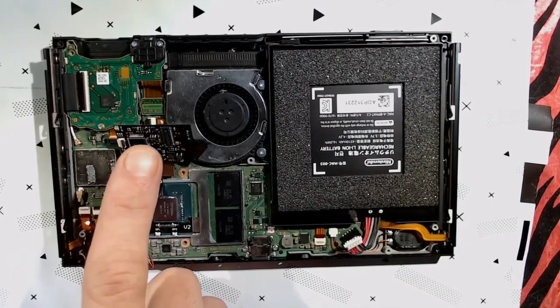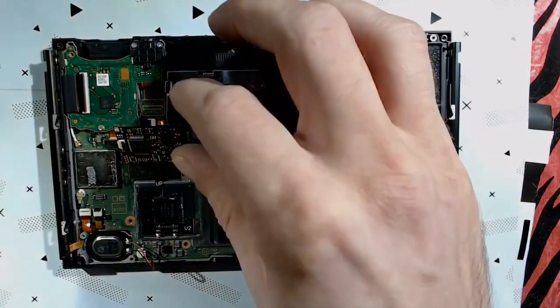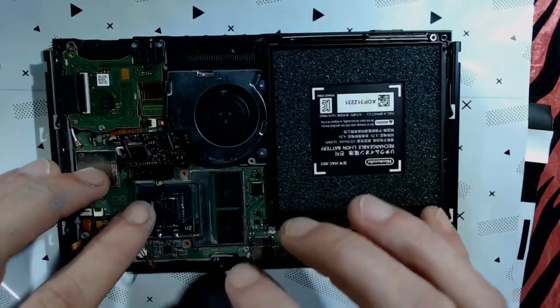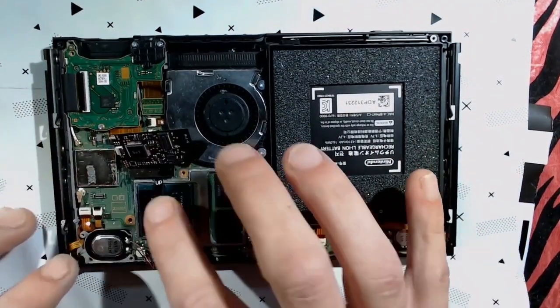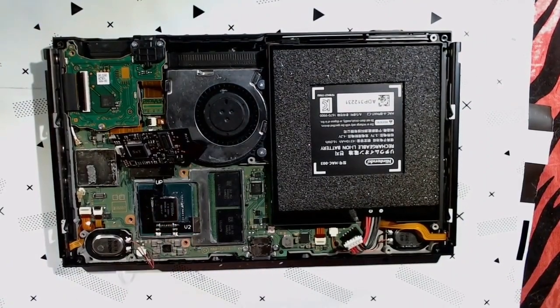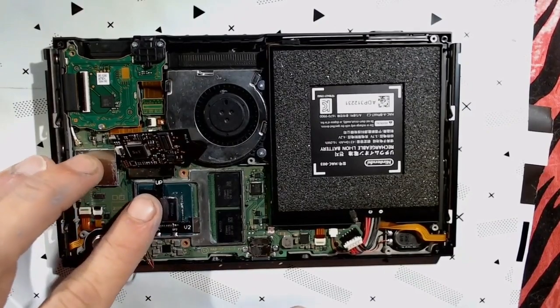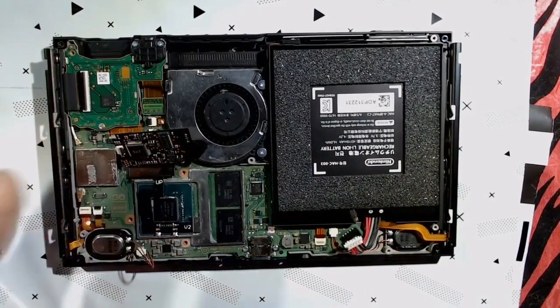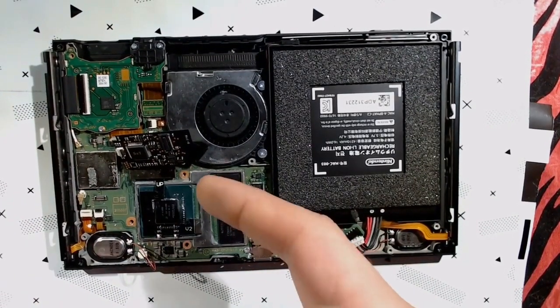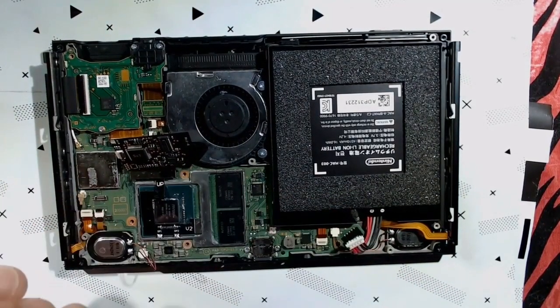Okay, so I bent the cable back for the chip right here, just so we can go ahead and work calmly in this area. Now, we're going to be reattaching the heat spreader. My cable's kind of bending up a little bit wonkily, so I want to push it down before going any further. Use my tweezers just to get the tension coming to this end of the chip here.